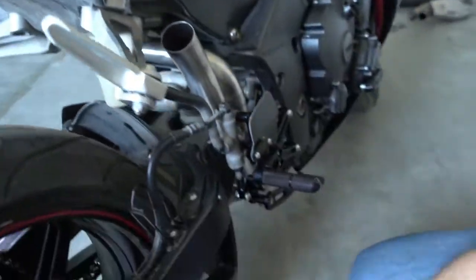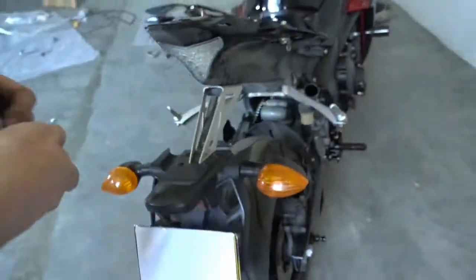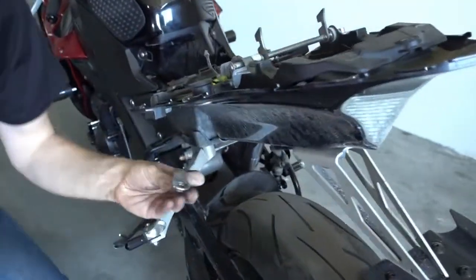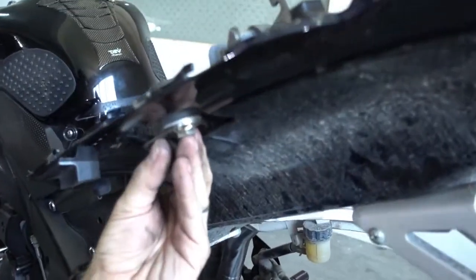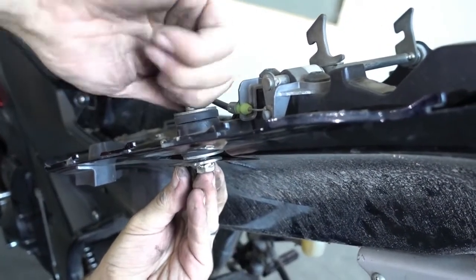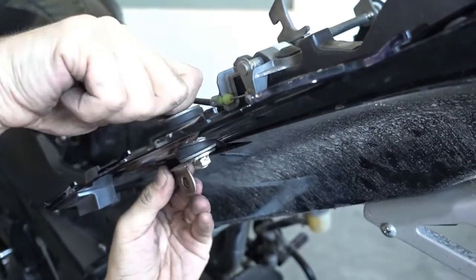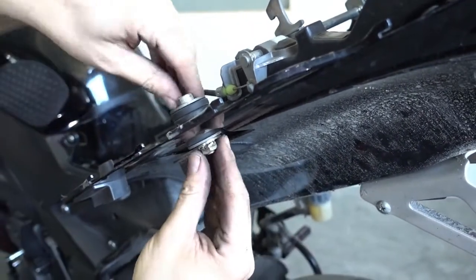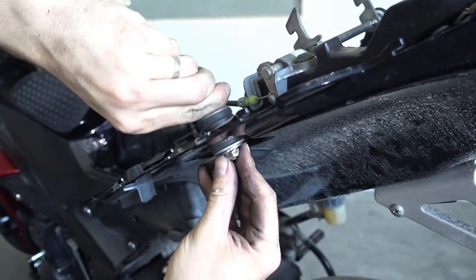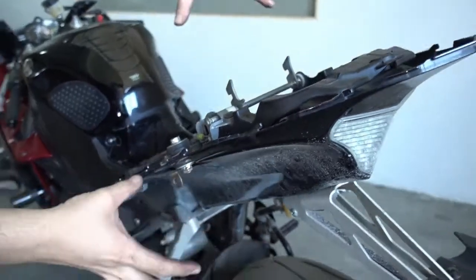I do the same now on the other side. Put the bracket down here, put the bolt through, and make it hand tight. We don't tighten the bolts completely now because we still have to mount the muffler, so we might need to adjust the position a bit. It's enough if you make them hand tight now. That was this. Now we put on the mid pipes.